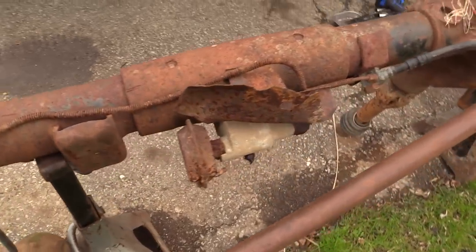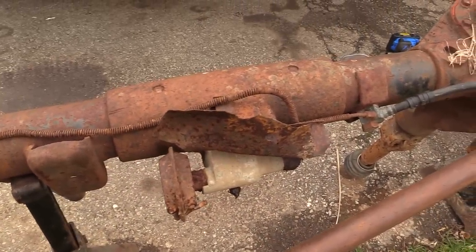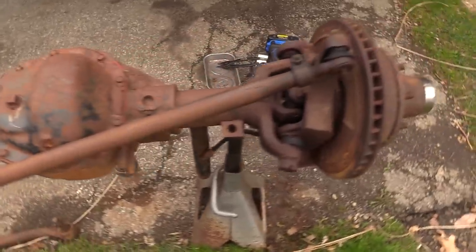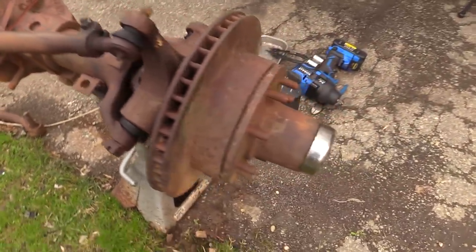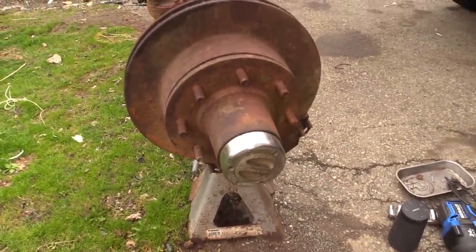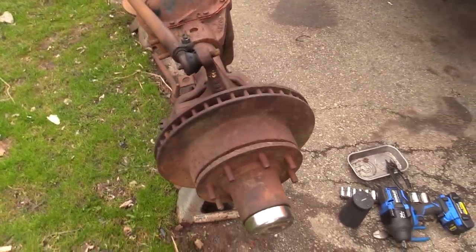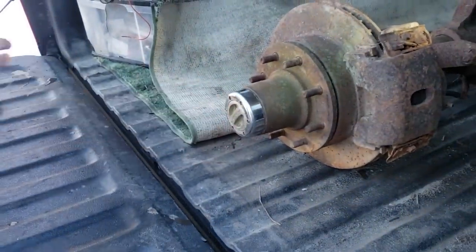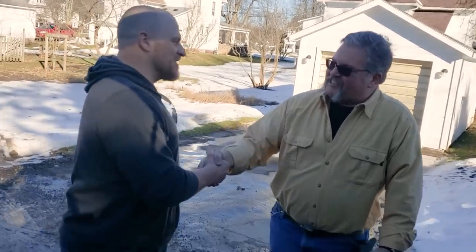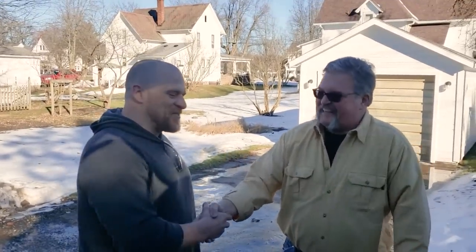Can you tell me briefly - is this what you call the CAD design? Yes. I think the center axle disconnect appeared in '86 or '87. We still have locking hubs - well, somebody has added the locking hubs, so those weren't on the original design. The original had a push-in dust cap. Those are Mile Marker hubs, so you end up with basically full-time hubs on the outboard end.